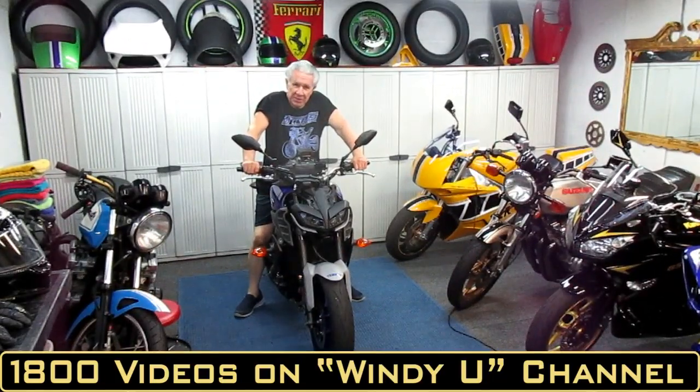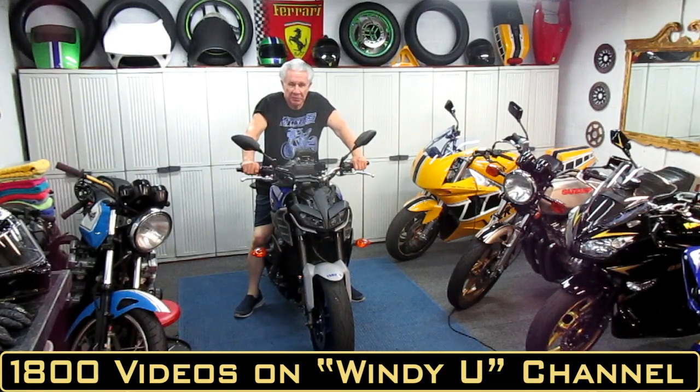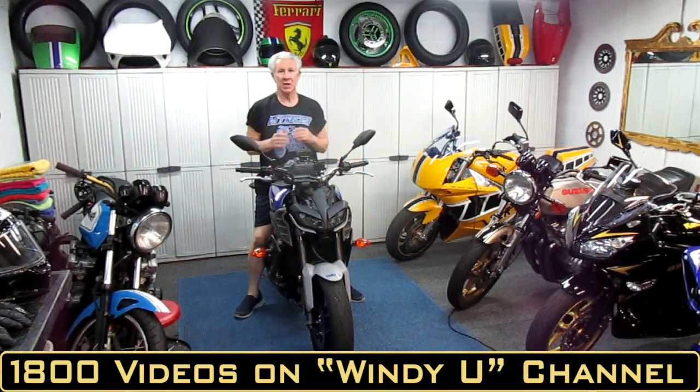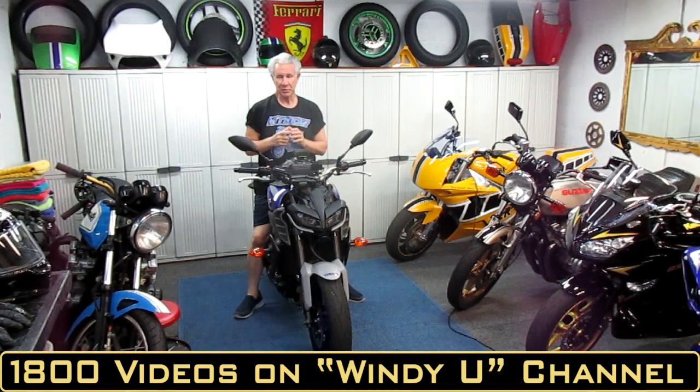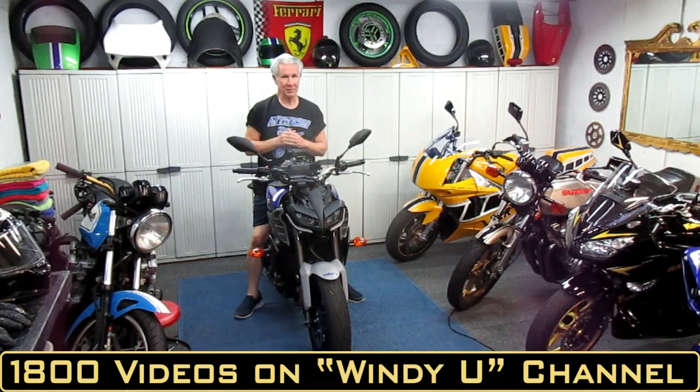So the last couple of days have been some very interesting fooling around with the suspension, the rear suspension specifically, and getting that shock right where we think it is. I'm going to go out today and give it one more test, and the test will be on 3 notches out on the spring, and in the middle, medium setting, it's a 1.5 turns out. That's pretty much where it's going to wind up after 2 days of testing. I've had it harder, I've had it softer. That looks like for a 190-pound person that's riding on bumpy roads in the summer, that's going to work pretty good.